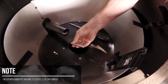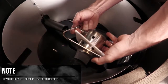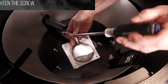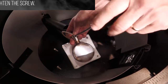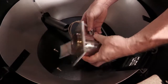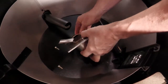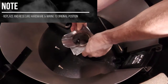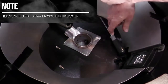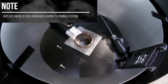You can see the igniter here — we're going to pull it through and put it into the right adjustment, which is basically flush on the back. I know from experience when it's flush on the back, it's about right. Just snug that up — you do not need to get that super tight. Confirm there's about the distance I need. Slide that back in, twist it, get all your holes lined up, put your four screws back in, plug it back in at the back, secure the wires, and you're good to go.